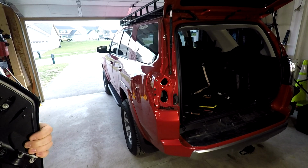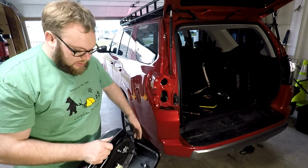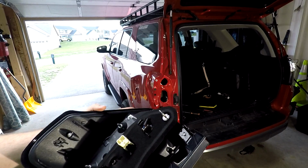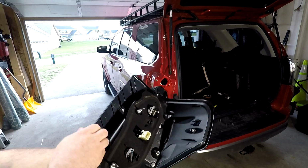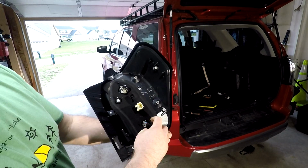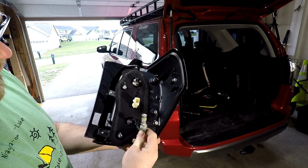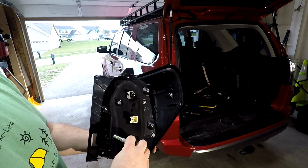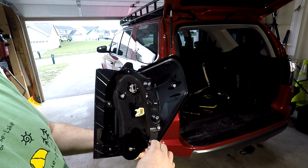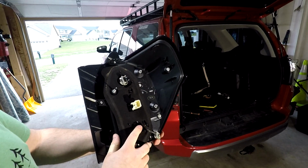Okay? Now, if you have a stubborn light, let me show you what else you can do. Basically, you see these two big holes right here? Those go right through the body, right to the tail light. So, very carefully, what you can do is remove, just by rotating counterclockwise, the lower bulb, and maybe the upper bulb if you really need help, but at least the lower bulb. Take it off, get everything out of the way. Remember, the clip is right here next to that bulb.